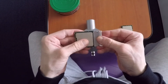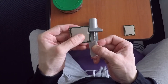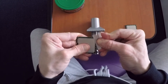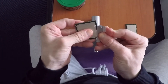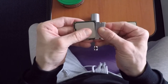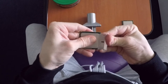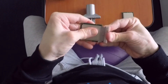...rubbery silicone that connects the heat spreader with the CPU die. The thickness I just showed with the blade is a guide for you on the heat spreader itself, so the top part actually shows exactly how deep you need to cut. The same goes again: you check the bottom part of the CPU and align the blade parallel, just right above the small golden dot as you can see.